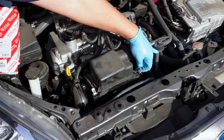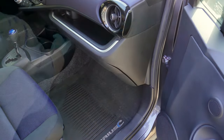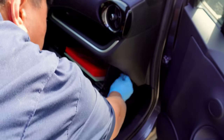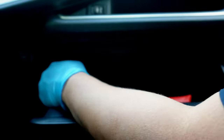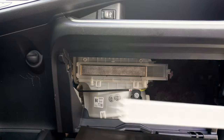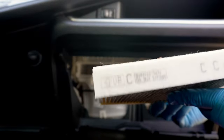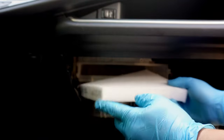Now that we're done with the engine air filter, we can move on to the final maintenance item, which is the cabin air filter — also a Toyota OEM part. The cabin filter is located behind the glove box, which requires no tools to remove. The first step is to unclip the retaining bracket for the glove box. Once that is removed, there are two tabs near the top of the glove box that need to be squeezed inward to clear the dashboard. That allows the glove box to fall off its hinge and be pulled out. Squeeze the tabs on the right side and the cover will pull right off — right behind there is the air filter. The filter can then be removed, and this one is completely used up. You'll also see that there is writing on the left side with indicators on which direction the filter goes in. The new OEM filter has the same writing, so we'll make sure it's pointing up and that the writing is on the left side facing the driver's seat.